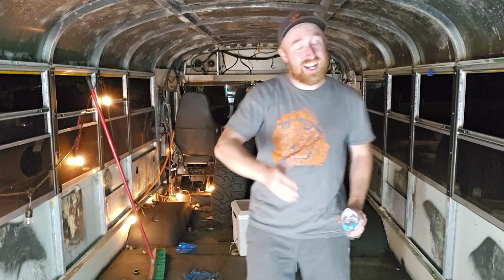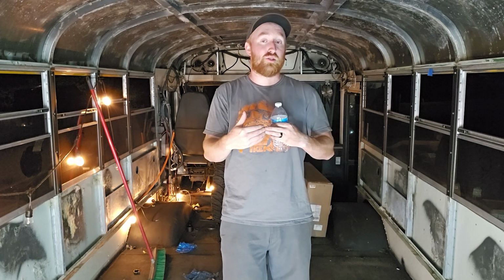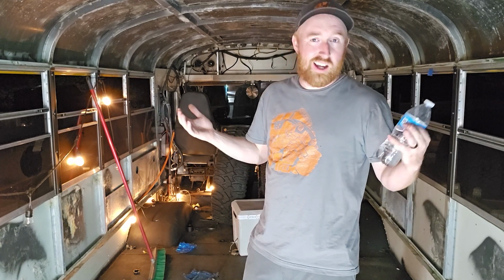I am staggering the 4-foot sections. There's a crack in the plyboard, there's a crack in the insulation, so that means those two aren't on the same exact crack, so it helps eliminate the uprising from a joint coming together. It kind of makes sense, right?